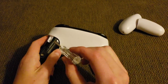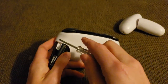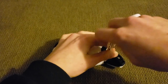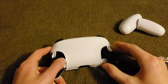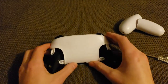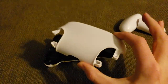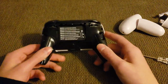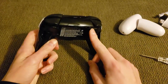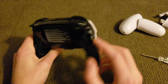To take off the back plate, use your small screwdriver to undo all four screws. Once you do that, you should be able to pull the back plate right off. I recommend leaving the screws in their original positions in the plate piece since the design lets them sit in there. You'll then be met with the back of the controller, which is black regardless of what color shell you have — it's the internal shell of the pro controller that you don't normally see.